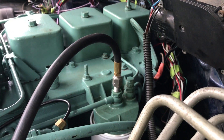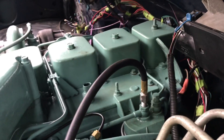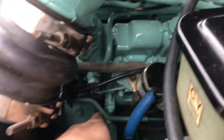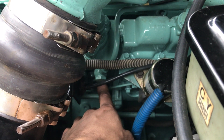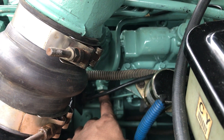You're going to have to either make an adapter to fit in the bleeder bolt on top of the fuel filter housing, or if you follow that line that comes off right there and comes around the injection pump — so that's your other feed line. This is really a better place to do it. They do make a kit from Torque Tech — I think that has a 1/8 inch pipe thread on it.